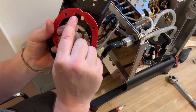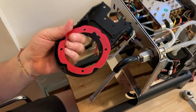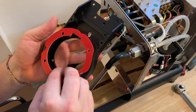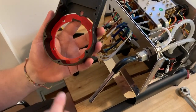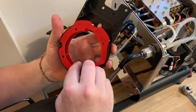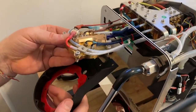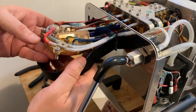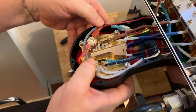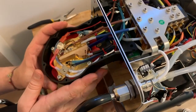We're going to insert our heat isolation spacers — both are marked 'top' which just denotes the top of the spacer, not top versus bottom of installation. Go with the two millimeter spacer first — insert it into the support; it has cutouts so it fits right in. Next insert the 0.8 millimeter isolator. Then lift up the WPI and in reverse of what we did before, insert the support into the hole in the chassis, lower the WPI into the new support, put all the bolts into their holes through the PCB heat isolators, and work to get the bolts back into the support in the chassis.